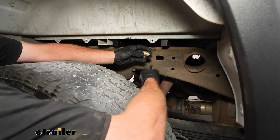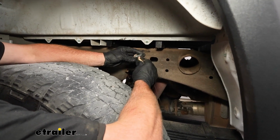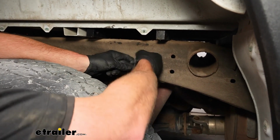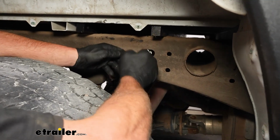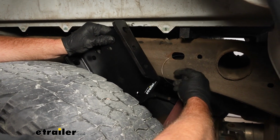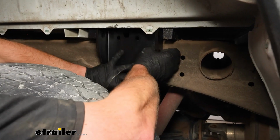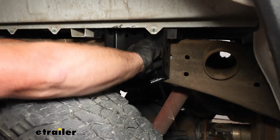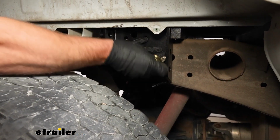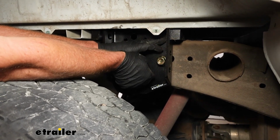You're going to take one of the big carriage bolts and a spacer block, put that on like that, and then take one of the pull wires, thread it onto the carriage bolt. And we're going to pass the bolt into the frame, and then the spacer block. You can pull it out, and then you'll grab your side plate, take that end of the fish wire, put it through that big hole there. I'll pull that hardware through there. Go ahead and remove the pull wire. You can take a flange nut and just get that started hand tight, just a couple threads so the bolt doesn't fall back into the frame.